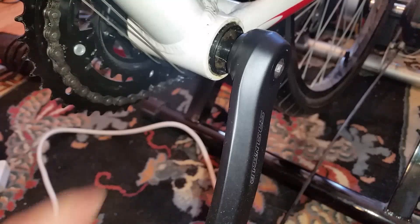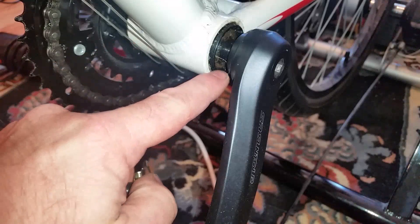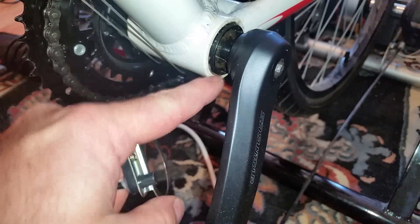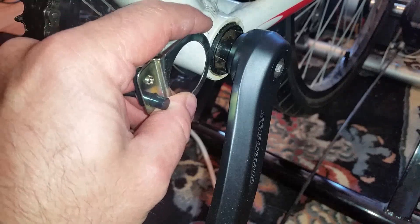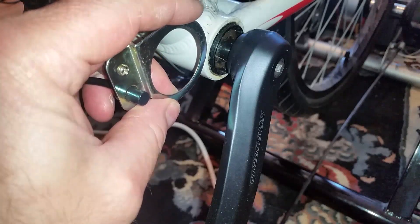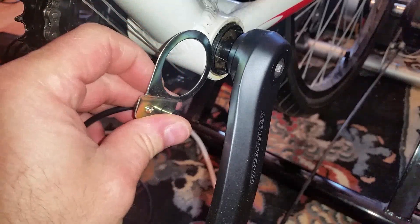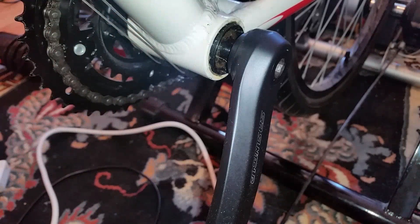I've come to fit the cadence sensor, which should go around the bottom bracket with a locking nut - but my bottom bracket doesn't have a locking nut so I've ordered one, hopefully with enough threads to lock it down. As it happens, if you're using the thumb throttle you don't actually need the cadence sensor - it ignores its presence anyway. The cadence sensor is just for pedal assist, so if you weren't using the thumb throttle it would assist you with extra power from the motor while pedalling.